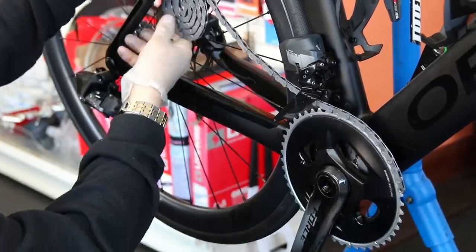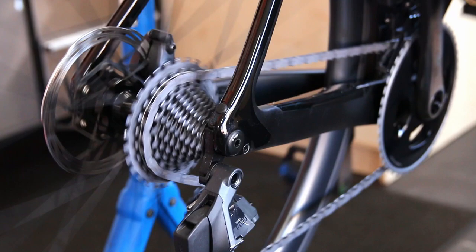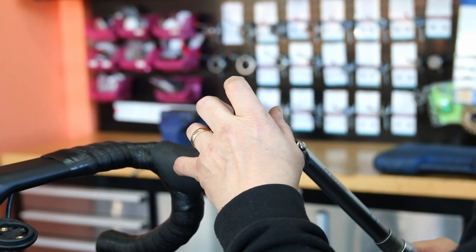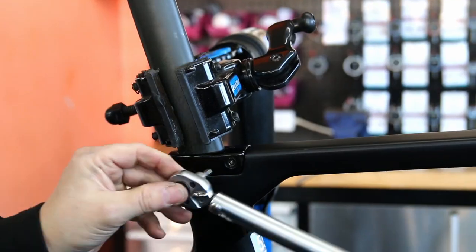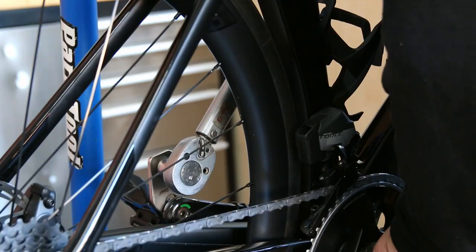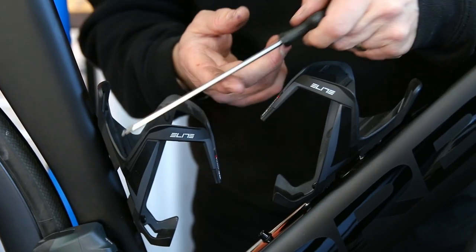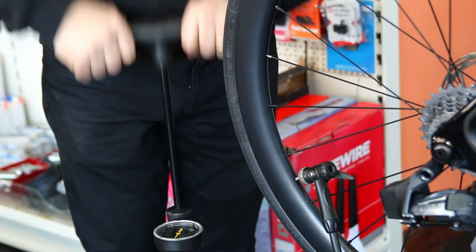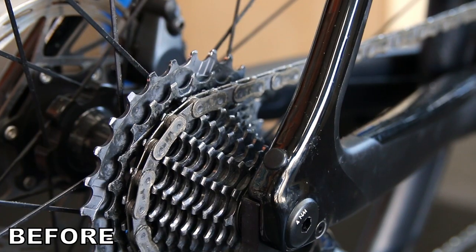This week we are thrilled — we've crunched some numbers on the channel and we've had great growth. We've had a best week so far for subscribers, breaking milestone after milestone, so thanks very much for all that. As you can see, we're just adjusting up the derailleur here. These SRAM Force chains are lovely — the best looking chain on the market at the moment. This bike ticked a lot of boxes for me: being an Orbea, having eTAP, having that SRAM chain — it was just lovely. I'm now glancing over it with a torque wrench, checking all the torque settings, making sure everything on this bike is correct — even down to the bottle cages. We check everything, pump up the tires — this bike is now spot-on and absolutely ready to ride. Thanks for watching, and we'll see you again next week — take care.